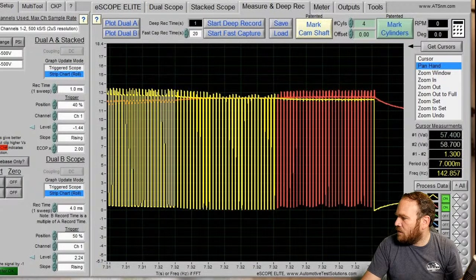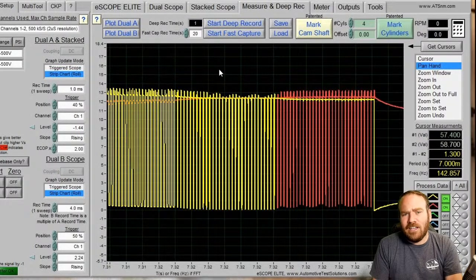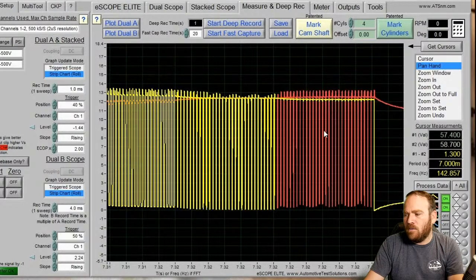Okay, he doesn't have another one. Doug normally stacks up some pictures in here, but not on this one. So this is all we have on this one, which is normally all you need to look at, unless you're setting a code for throttle body overcurrent, and you stick an amp clamp on there just to see how much it's pulling. There's normally not known good waveforms on the current waveform, but there will be lots of reference waveforms with the throttle body voltage.